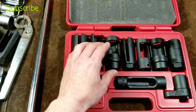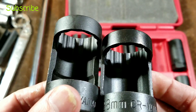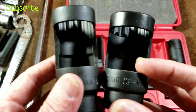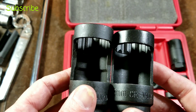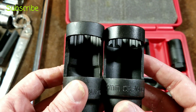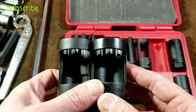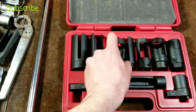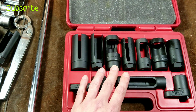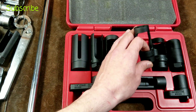I've had several oxygen sensors where these sockets were just fine — it's just when I had one slip that I was seeking something a little bit stronger, and I saw this Harbor Freight set. The diesel injector sockets are a bit more cut out. It's interesting how the 27 and the 28-millimeter are so different — the 27 looks pretty heavy-duty with a thick wall, where the 28 does not. One thing that attracted me to these is using them along with valve spring compressors, or using custom wooden dowels and rope, which sounds weird, but I've seen and used that several times. You use these for pushing down valve retainers and doing valve stem seals without pulling off cylinder heads, and if you take it seriously and do it properly with proper polyurethane rope, you can get away with using these as valve spring compressors.